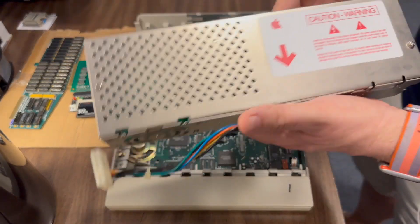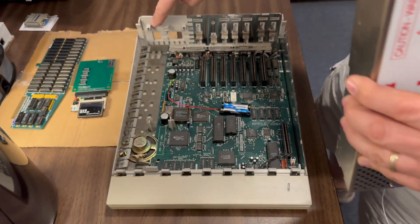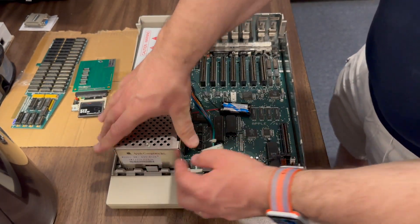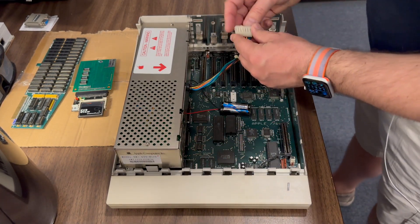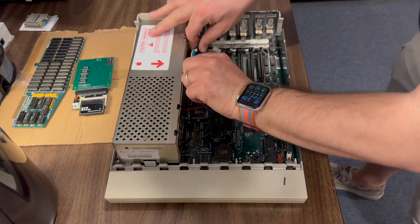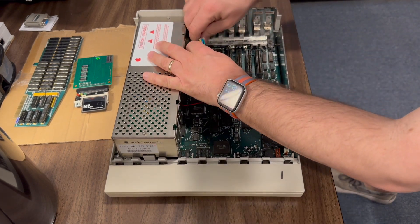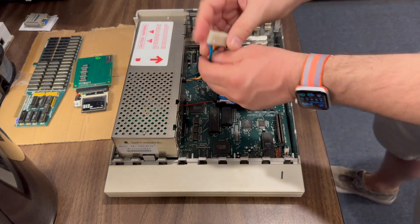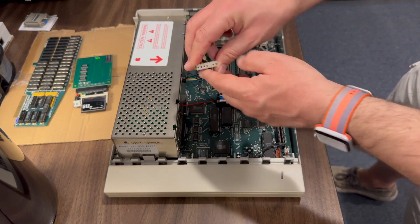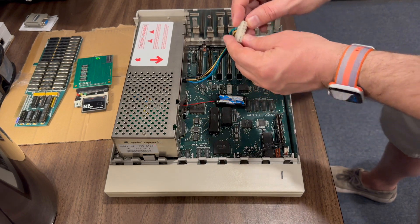Now we'll have the completely refurbished Apple IIgs power supply — we'll slide this right back in. Just remember there are three grooves on the back here which go along to the back of the Apple IIgs, so we'll just slide those in and sort of drop it in. Watch out for that plastic clip up here, and then we run the cable over to the back. The power strip connector is keyed — there's a plugged adapter, so when you're going into the terminal on the motherboard, in case you don't remember which way it goes, that key is there so you can plug it in correctly.